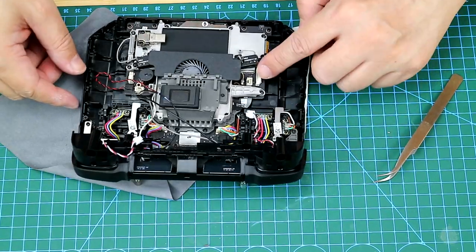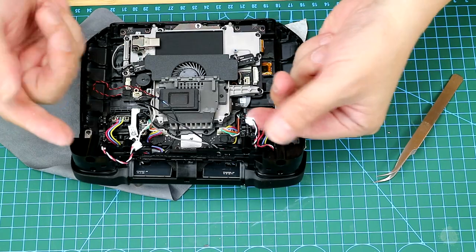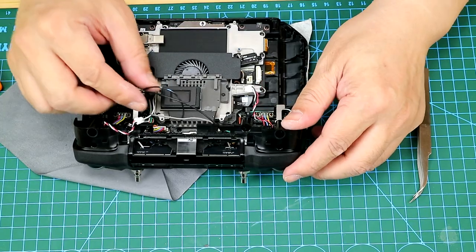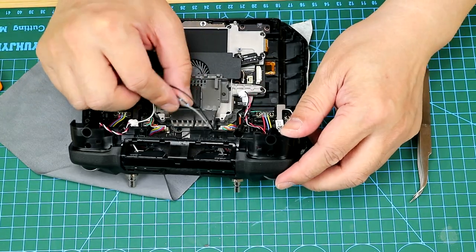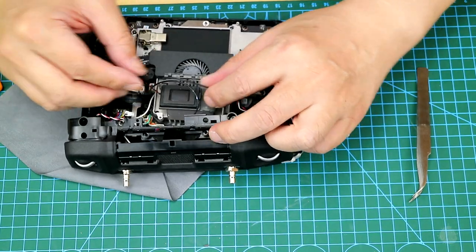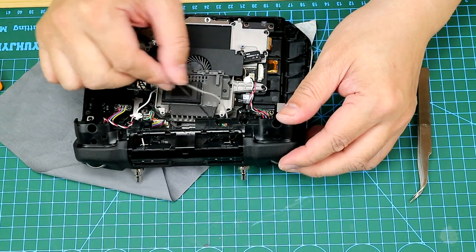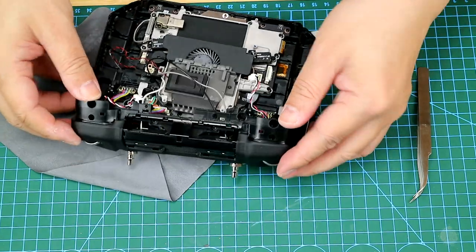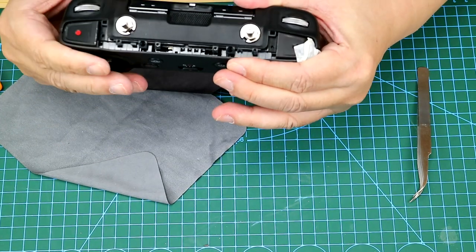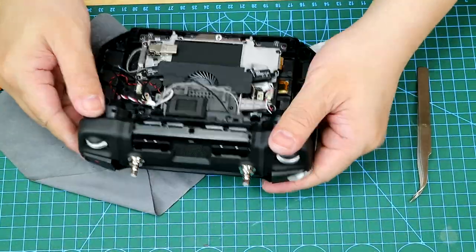With ALIENTECH signal boosters, the antenna gain can be as high as 15 dBi, and the standing wave ratio can be 1.2 to 1.3 dB, which is close to a military level. The RC Pro antenna has 3 to 4 dB, for example. Its omnidirectional antenna has 3 dB, and its directional antenna has about 4 dB. But ALIENTECH antennae have about 13 to 14 dB. So the overall performance of remote controllers can be significantly boosted, no matter in terms of input or output.